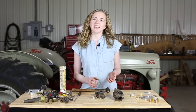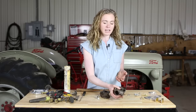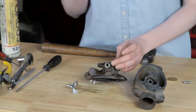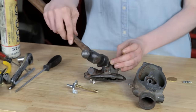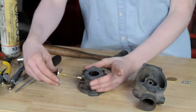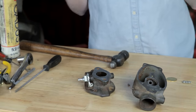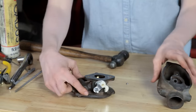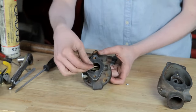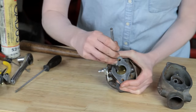I have my carburetor thoroughly cleaned. If you want to paint your carburetor, now's the time — just flip your two halves over so you only get paint on the outside. I'm ready to put new parts in. Up at my throttle shaft I already have my new packing in there — there's a small white felt piece and then this brass cover goes over top, and you just tap it in with a ball peen hammer. Then you can slide your shaft in. I like to put a little bit of grease on there. This is directional, so make sure yours is in the correct configuration. Then you're ready to put your butterfly in — notice that there are numbers on the top that always go up facing you — then line that up with the holes.